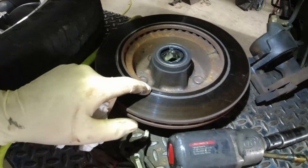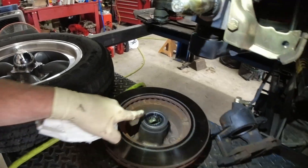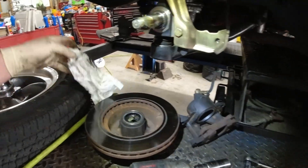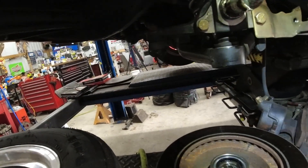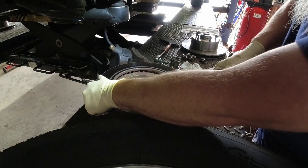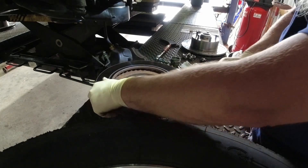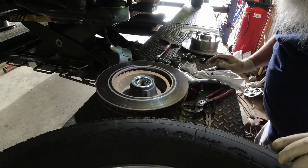We might grind this just a little bit more and repaint it. I don't want to end up with another groove in my rotor because I can't stand the brake squealing from it. We'll pop the seal out. The seal is really in there — I may have to damage it to get it out. Probably going to have to get some new inner bearing seals.